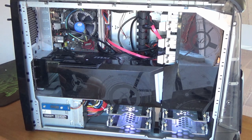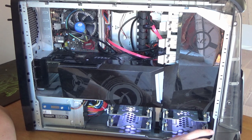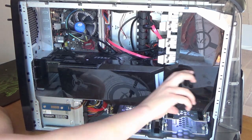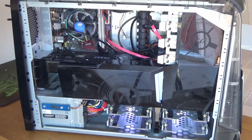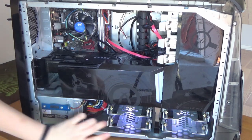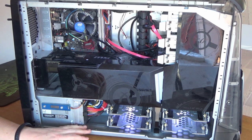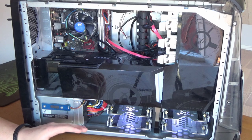But yeah, as you can see, the PC is designed in a very particular way. There's essentially three zones. It's built on the philosophy of essentially air ducts, which is kind of odd, but it has an air duct down here, and then a cooling zone or an air duct here, and then one up here. So it's divided into these three pieces, and it kind of does this in two ways. Down here, it's actually sealed. You see there's a top and there's a bottom where it seals like this, and you have air passing through here over to the power supply, and yes, this is the original Aurora ALX power supply this came with. It's actually 875 watt, silver rated, which is really good. And it's new old stock, so yes, this has been in storage for a long while, but it has never been used before.